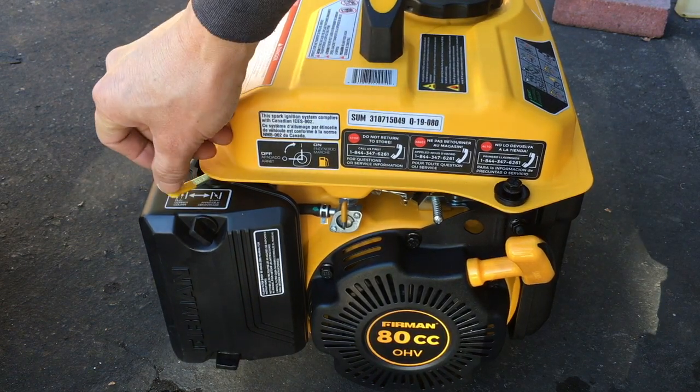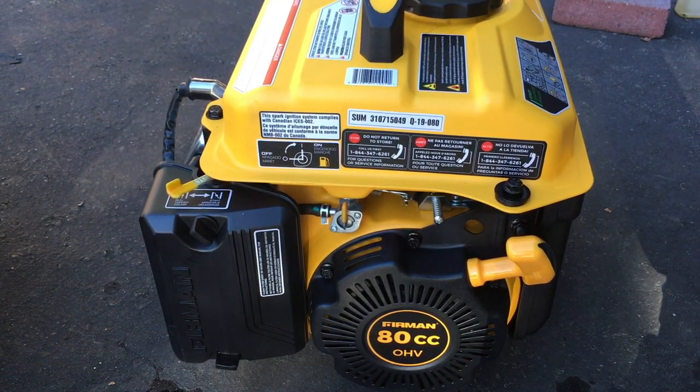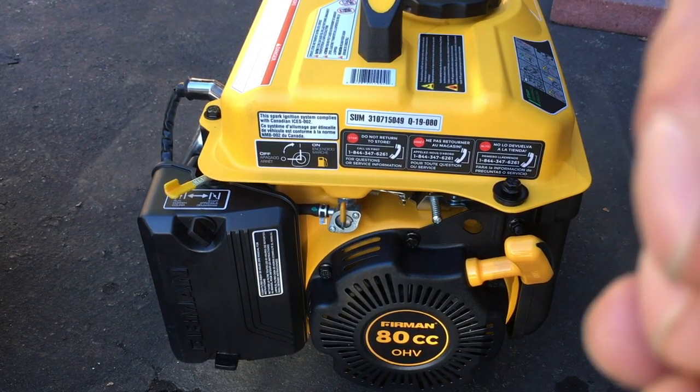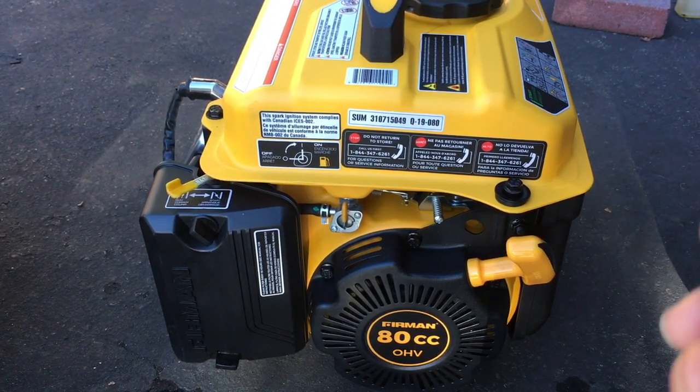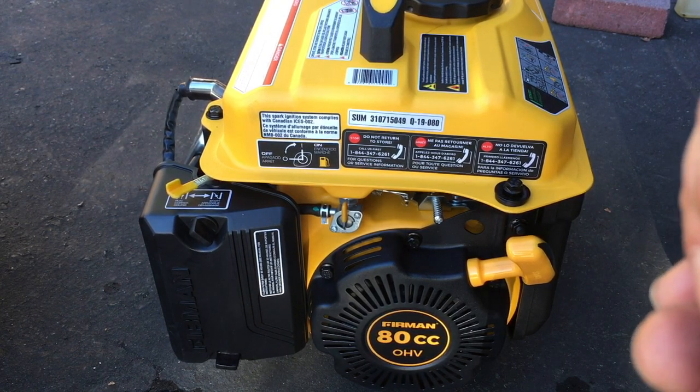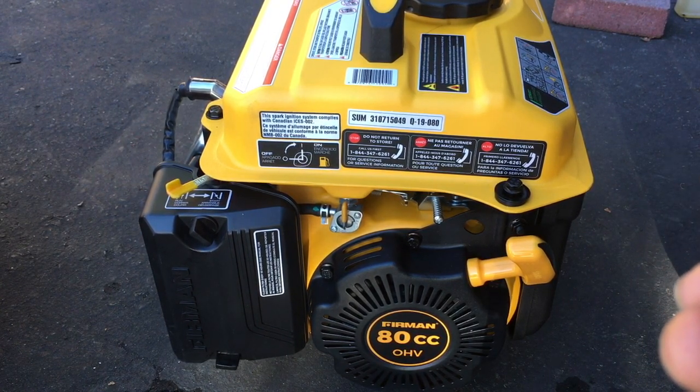That's it. I'm just gonna leave it like that for maybe 15 minutes, let it fully warm up, and I shut it down. And I do it again tomorrow, and I do that like 3 times or so. After that, I will put some kind of load on it for like an hour. Then let it cool down again, and it should be good to go.